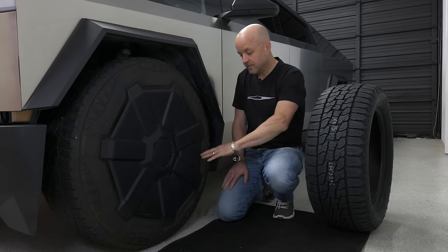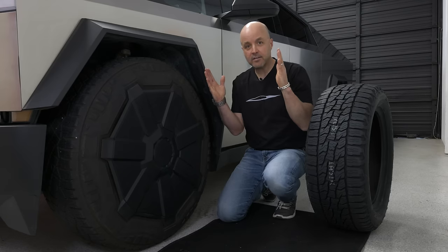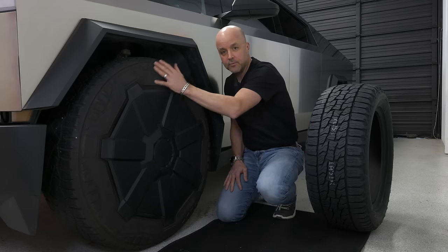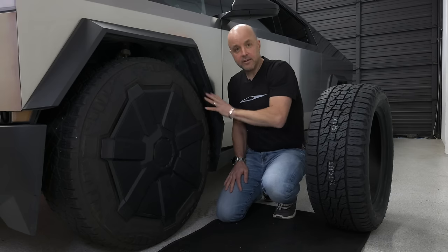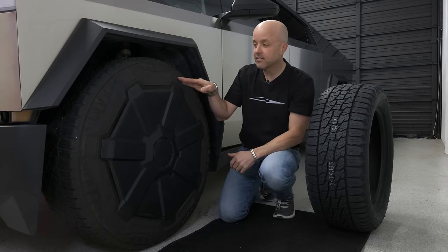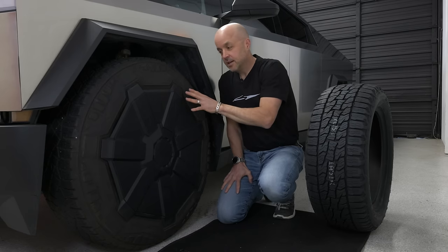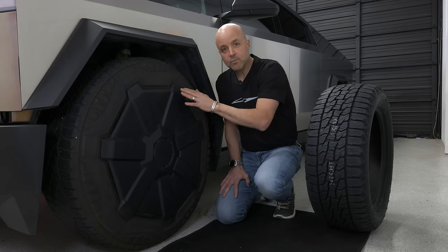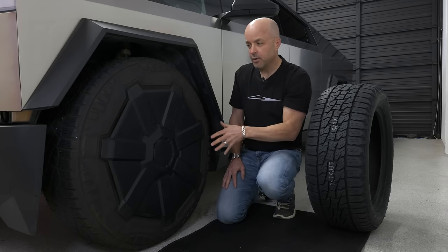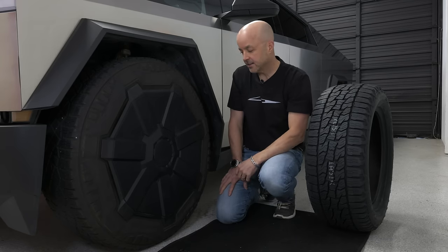As the tire comes up and you come off the contact patch, the tire sidewall conforms back to its original shape on the up-sweep and the fingers let off the tire. But every time it rotates, these are digging into the sidewall. So unfortunately, that's caused the sidewall to wear down where these rubber caps are. I'm going to pull this aero cover off and bring you in close to show you exactly what's going on.